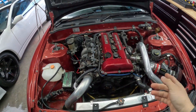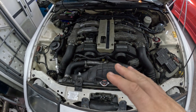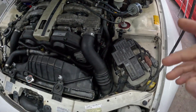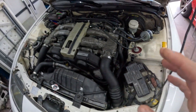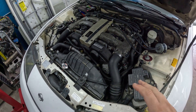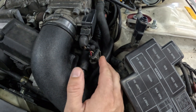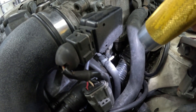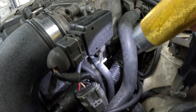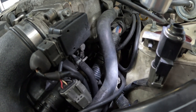This is why I say 240s are so easy to modify and work on. Over here is our 300ZX and it gets a lot more intimidating — it is worse, but it's still very doable. This one's got a lot of intake piping and vacuum lines running all over. This one's going to take a lot more to track down. As you can see, this vacuum line right here is in pretty bad shape — it's all dry rotted and that's going to give drivability issues for sure.